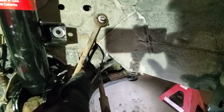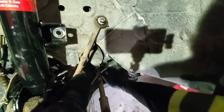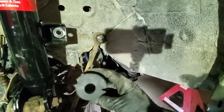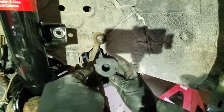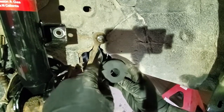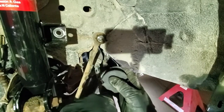This is the old bushing — you can see the bracket sits inside it. You should clean any debris and dust under the bushing; in my case there was lots of loose dust and mud. The new bushing should be absolutely the same — split on the front — with the shallower part going into the frame and the thicker part going to the top. Make sure the number on top of the bushing is pointing up.